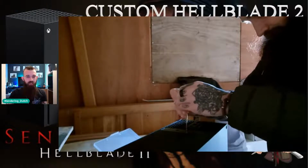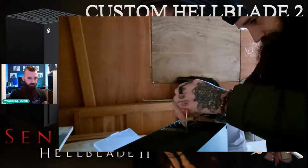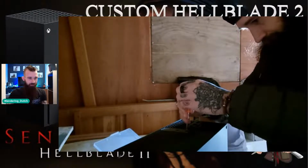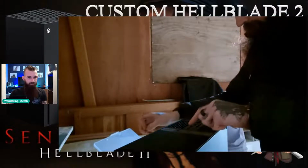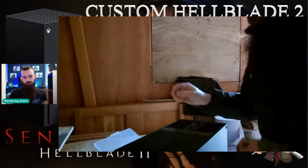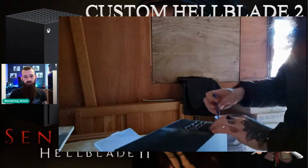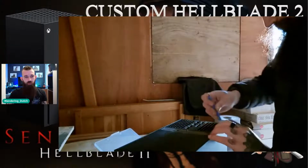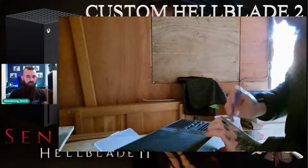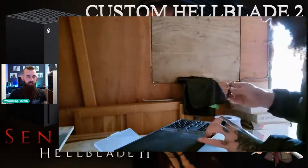First time prying it off does take a little bit of work. It has 2 little pry hooks on the bottom. Of course, this little plastic pry that I had wasn't really getting to grips with it first of all. Once you've had it off once or twice, then it becomes easier to wedge under. So I just used some metal pries instead.